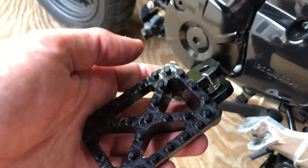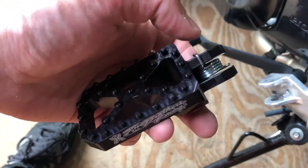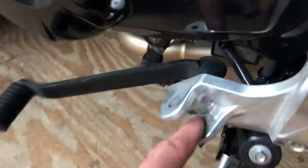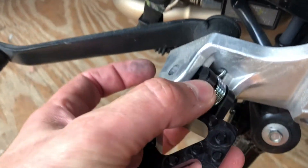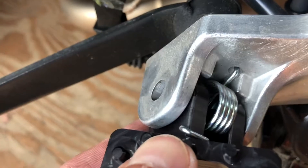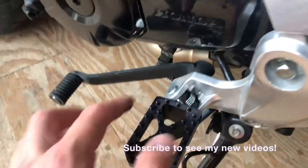So this is the left side. Grab the spring in this orientation — this is the left foot peg. Put the spring like that; this piece on the bottom is going to stick out and go into the hole on the rear set. Slide this in like this. You might have to push it up with your finger just to make sure it sits in there properly. Right now it's sitting in there and I'm holding it while I go grab the bolt to put through the top.